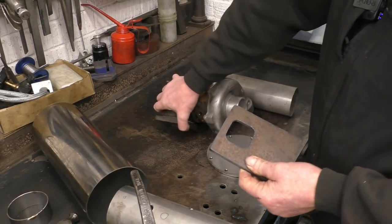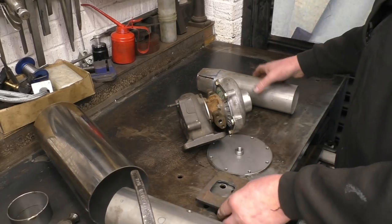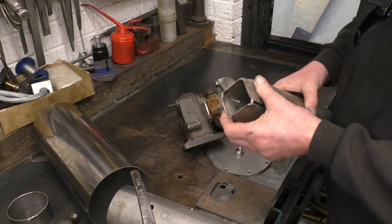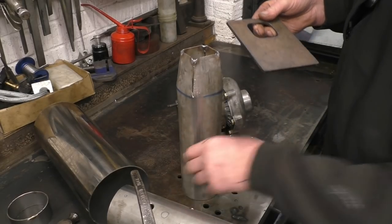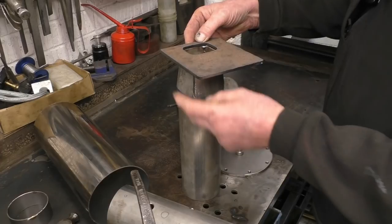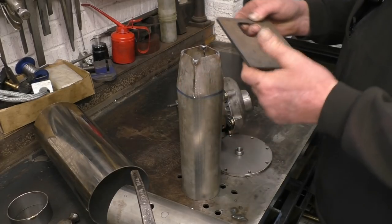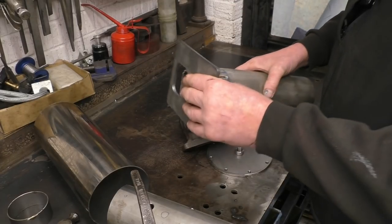When it comes out of the end it's got to feed into there, which is the same size as the exhaust inlet on the turbocharger. I've had a go at cutting a bit of stainless pipe and crushing it and hammering it to make it a reasonable fit. I'm going to try and weld this up with some stainless wire and see what it looks like, but at least now I've got some sizes to try and possibly make a better one.